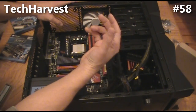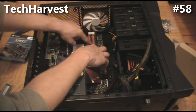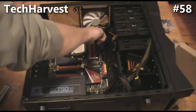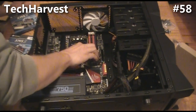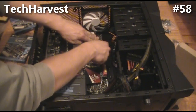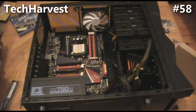If you're only going to put two sticks of RAM in, make sure they're in matching colors. Since I'm filling all of them it doesn't matter. You want to match up the RAM with the slot — there's a little notch, so match that up, put it in, and just push it in until it snaps. It's going to lock in on one side, make sure it's nice and snug, then go on to the next one.